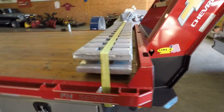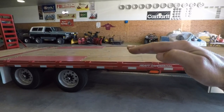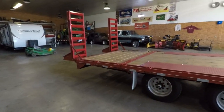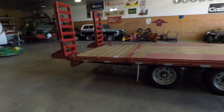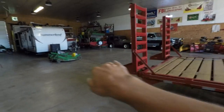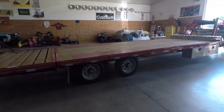Now to the ramps. I did buy a set of aluminum ramps — these are pretty heavy duty, 10,000 pound. The purpose for carrying these is even though this is a low profile deck — I ordered it with the low profile so the deck height is 33 inches instead of 36 — there are still instances when I have trucks that are so long, like these two-wheel drive cab chassis. They're so long and low that when you get the front tire up to the deck, there might be a suspension component or exhaust system hanging down that you cannot clear the transition. So I use the ramps to give me a better approach angle. I start the back tires on the aluminum ramp, it changes the approach angle, and you can clear and get right on. Very happy with those ramps.